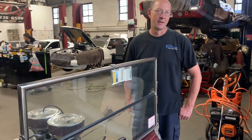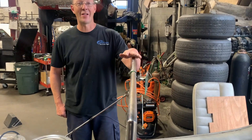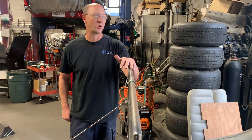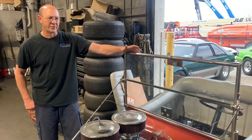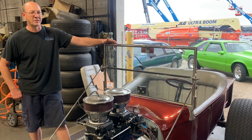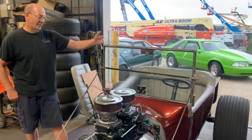The lifter swap is complete, car's back up and running. As we said in the beginning, it's really straightforward — the technical part is just getting the right pushrod length and setting that preload. If you're an LS guy you've probably done this already yourself; the engines are not very far from each other with a lot of similarities. We feel more comfortable going past 6,500 RPM through the traps now. The cam is a small Callie's cam but we wanted the ability to go past peak power to the traps. We also put 4.10s in, a UPR sway bar, and a breather — lifters are in, we're ready.